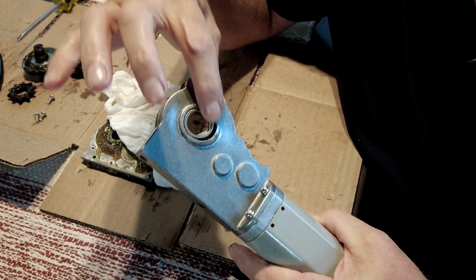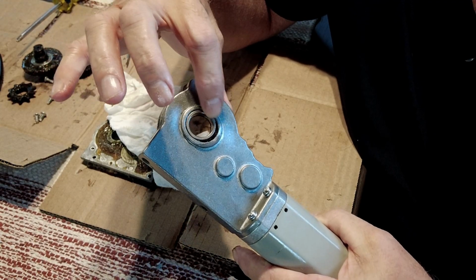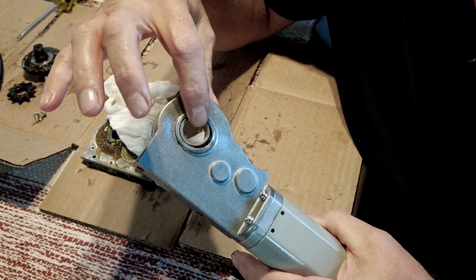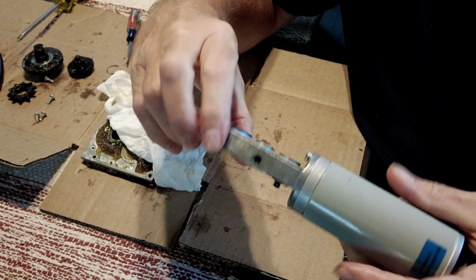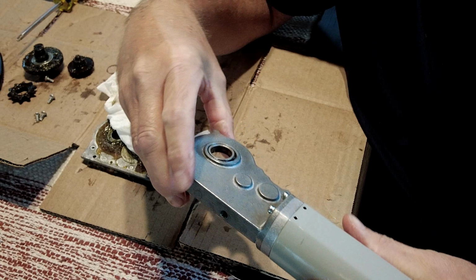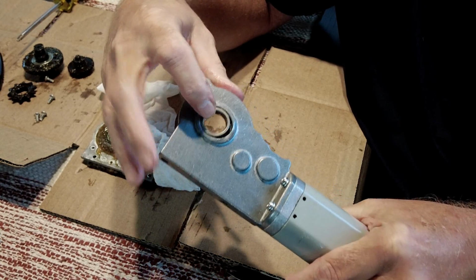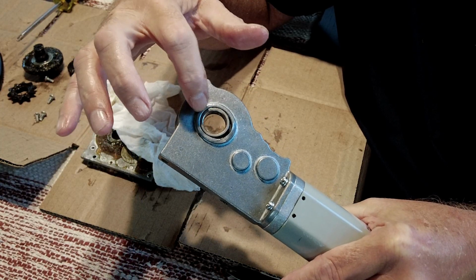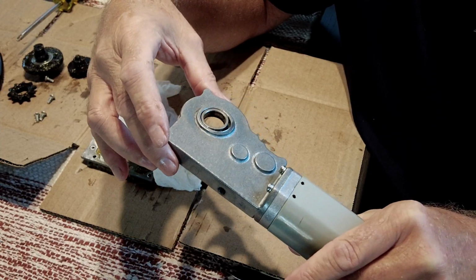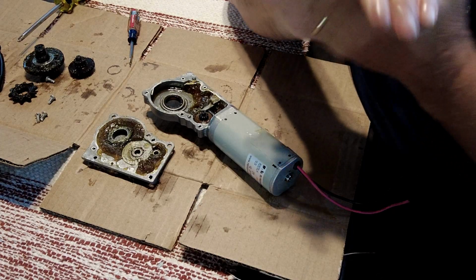When this thing was pressed in there crooked, it just took some time to wear those gears down and eventually just fail. What it looks like is a defective part from BAL, the company who makes the slide system. I would think that if the cables were too tight, we would see more wear on the inside of that bearing, which we don't. And it just looks like it's in there crooked, and that was machined wrong. So what it comes down to is BAL sent a bad part. Hopefully this one that they put in is a better part.